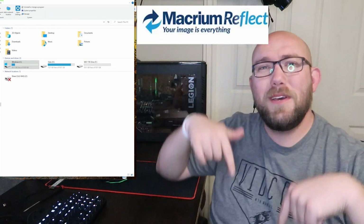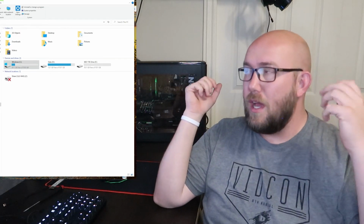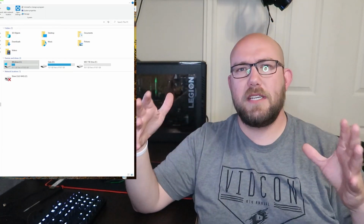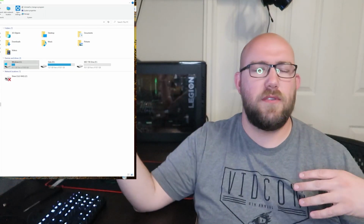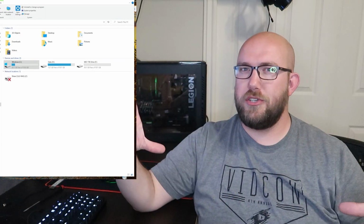Macrium? I don't know. I'll put a link in the description for you. It works. It works well. It worked perfect. So use this program. It clones it right. Just make sure you catch that little step if you're going to a larger drive. If you're using the same size drive, you can just hit next all the way through and it just clones. If you're going from like a hard drive to an SSD, something like that. But I definitely recommend this one. You just gotta catch that step if you're going to a larger drive.